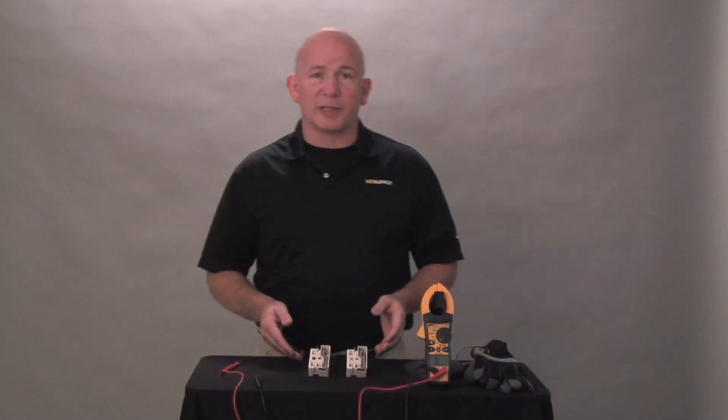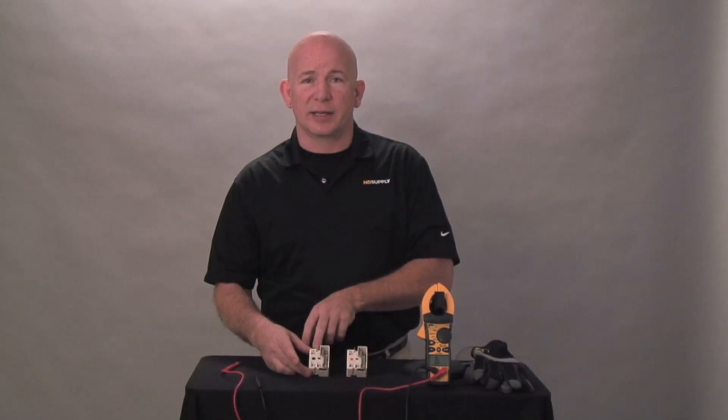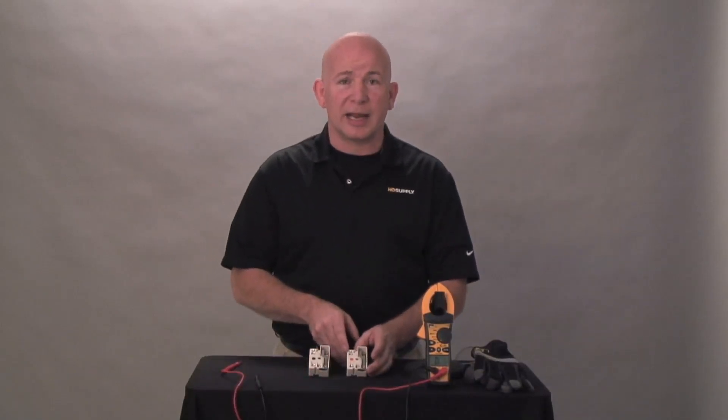When testing the infinite switch, there are always two types on a stove. The black dot usually indicates a six inch burner, where a red or an orange dot indicates an eight inch burner.